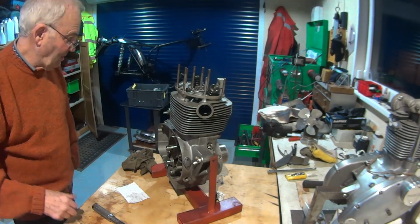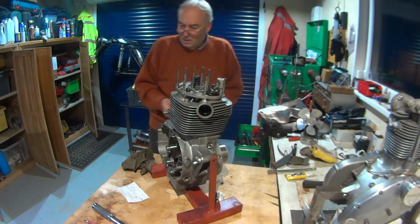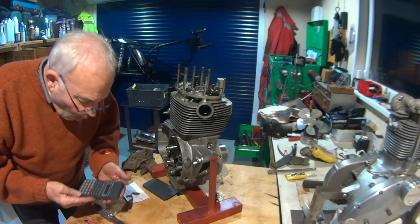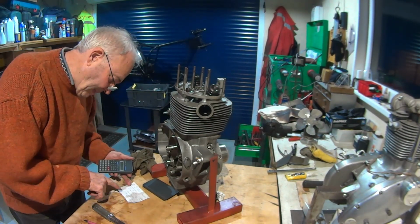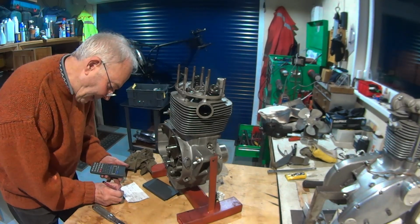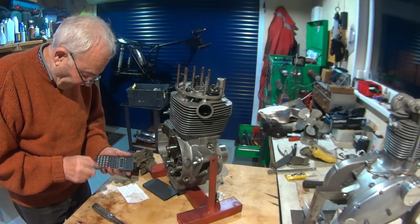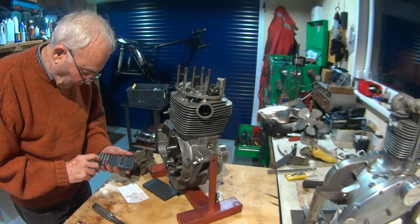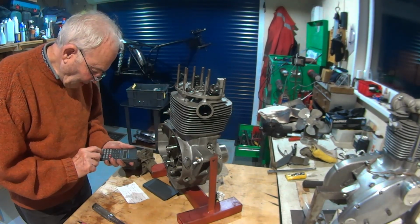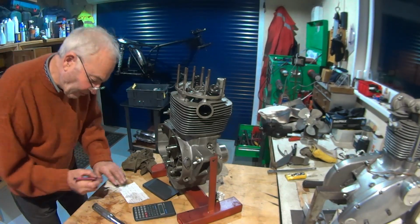Twelve. So calculator, I'm not going to do that in my head, am I? So 28 foot-pounds, so it's going to be 12 times 28 divided by the 15, isn't it? Yeah. So the first length is 12 times the torque loading figure, which is 28, divided by the new length, which is 15, 22.4, so we'll call it 23 because we can.